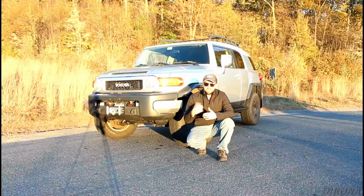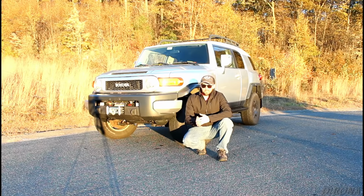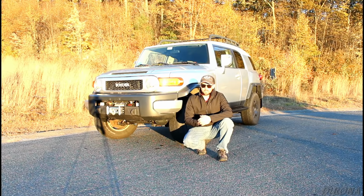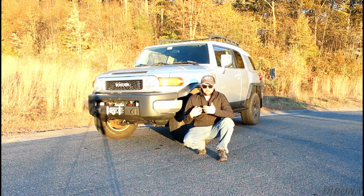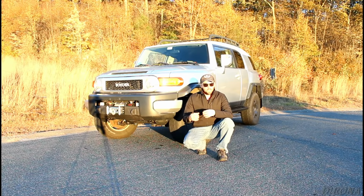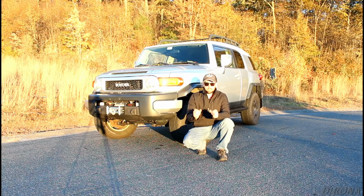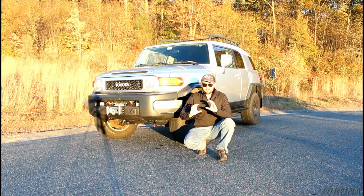So like I was saying, a lot of the stuff on here was so rusty I couldn't install these the way that I wanted to. And I just want to mention a few of those things. There are a few things I didn't show on camera either, just because they were such a pain in the butt being rusty. The biggest things that I didn't show that I think are really important, in my opinion, are the control arm bushings. So on the upper control arm, ideally when we're lifting a vehicle, we want to loosen the bolts that hold the bushings for the upper control arm to the frame. And then once the vehicle's at new ride height, sitting on its own weight, that's when we want to tighten them back up, or else the bushings will be twisted from a neutral position.